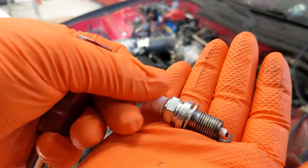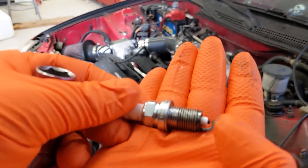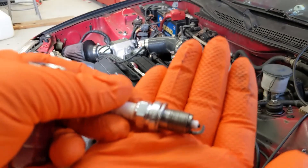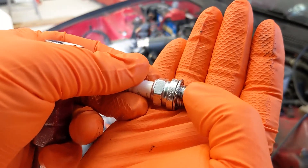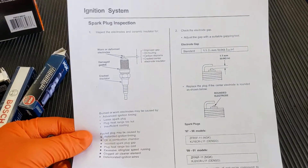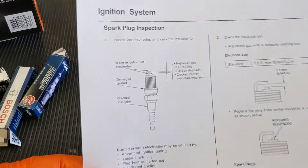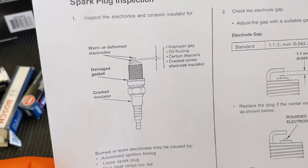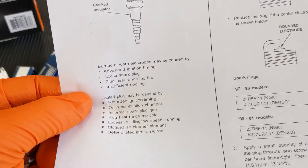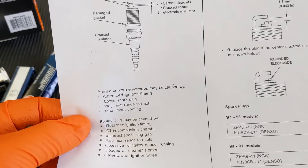This is just a regular old copper plug — we'll look at some other different plugs a little bit later. We've got the electrode in the middle and a ground strap that comes around. If this is a positive fire plug, the spark is going to jump from the middle out to the ground. With our plug removed, I've gone on AllData and printed off the sheet for spark plug inspections. It tells us exactly what to look for to see if this plug has been fouled out or if there's an issue with our motor, and it also gives ideas of what may cause the issue if you do have a fouled plug.